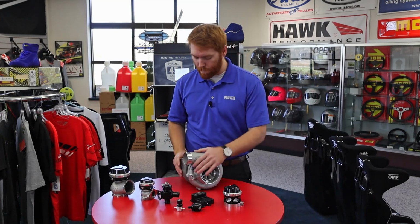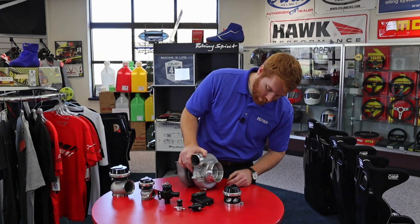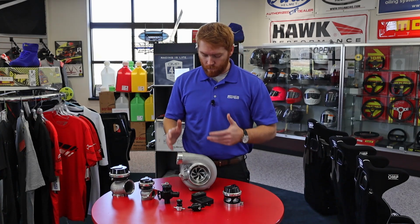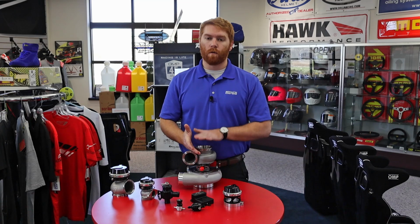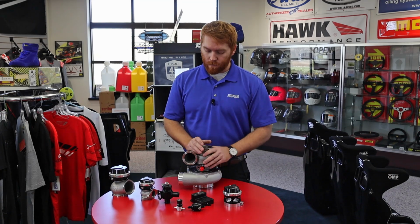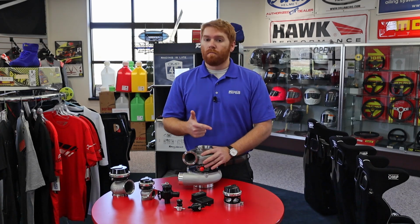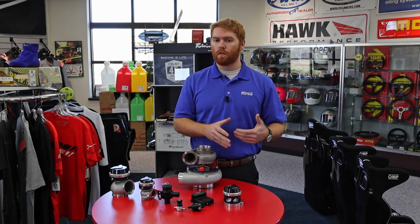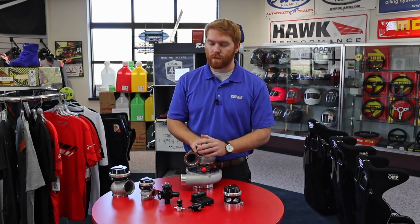It's really kind of basic, but the little intricacies of different turbos and different brands really change stuff. We can get into the pitch and the blades and the makeup of the compressor wheel itself. You could have a billet wheel, you could have a cast wheel. There's all sorts of different little intricacies, but ultimately you're looking for a proper turbo that's sized exactly for what you need. Things that change that are RPM limit, where you want to set your red line. Cam size. If you have a really big cam and you want a turbo that's going to come in sooner, it's probably going to take a smaller turbo to do that, just because down low that engine's not making all that volume that you would normally with a very mild cam.